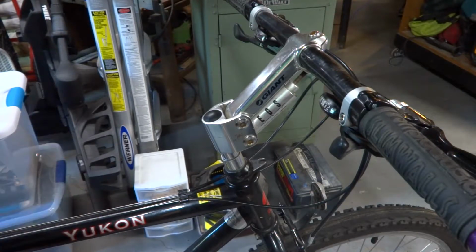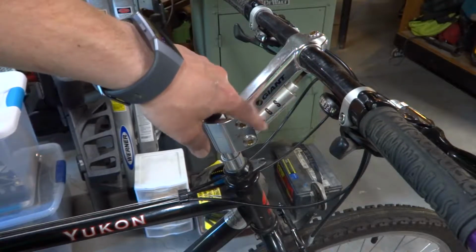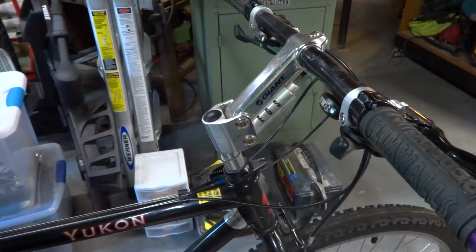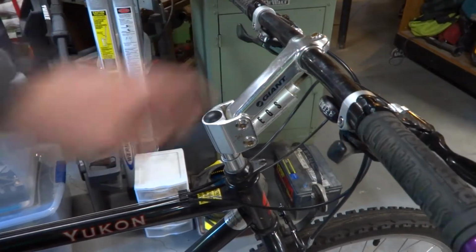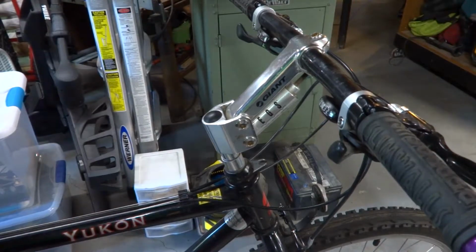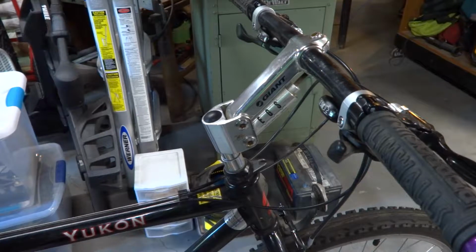And there is one danger to it. As it wears out, and as I got older and got bigger, this becomes more of a danger, because if you hit a bump with it, it has a tendency to kind of pop you back up, and if you aren't ready for it, it can kind of put you over the handlebars. So I would not, in good conscience, let somebody else ride this with that stem on it. So I'm going to swap it out with a solid Quill stem, and that way when one of my friends borrows the bike today, it'll be a little bit safer for them.